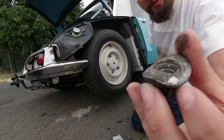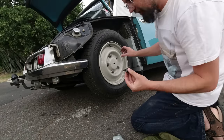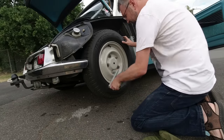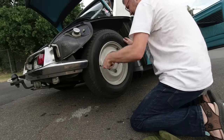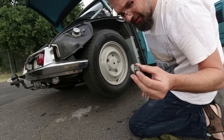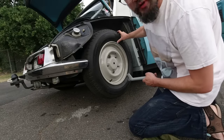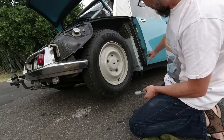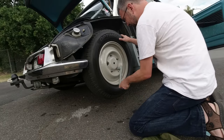Incidentally, it seems to use exactly the same wheel nuts as a Citroen 2CV, with this little shoulder on, which is a pain because they get caught as you're trying to put the wheel back on. I can't put the handbrake on — or rather, I can put the handbrake on, but it's on the front wheels, not the rear wheels. Because as the suspension goes up and down, because of the trailing arm design, the wheelbase gets longer or shorter depending on where the wheel is. So you can't have a handbrake on the rear wheels.